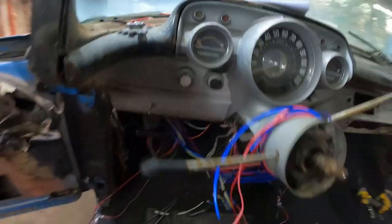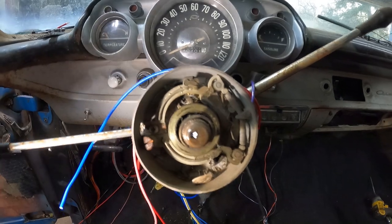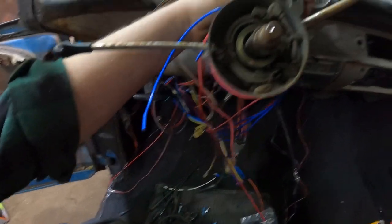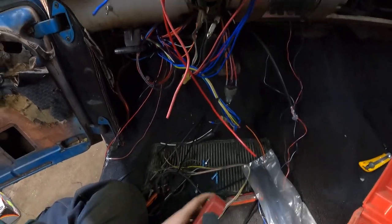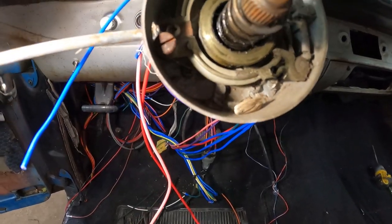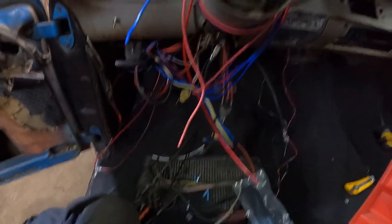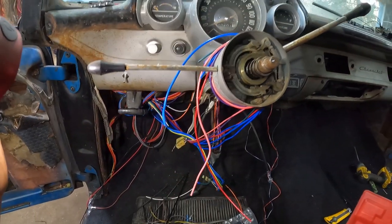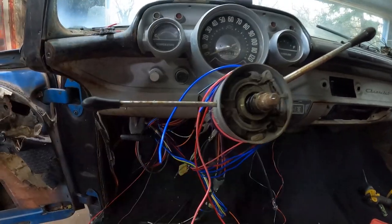In here you can see the mechanism - everything is working in there. Unfortunately this little piece is on the back side. This is a known good one - Murf fixed this years ago. This one I'll probably take apart and clean - that's all it is, it probably just gets dirty. But everything's all together. Dead moth. So I'll take this junk off real quick, replace it with two screws, put it back together. I should be able to test it with it all apart like this, which is nice. If that works, we'll slide it back together, clean up the horn ring.